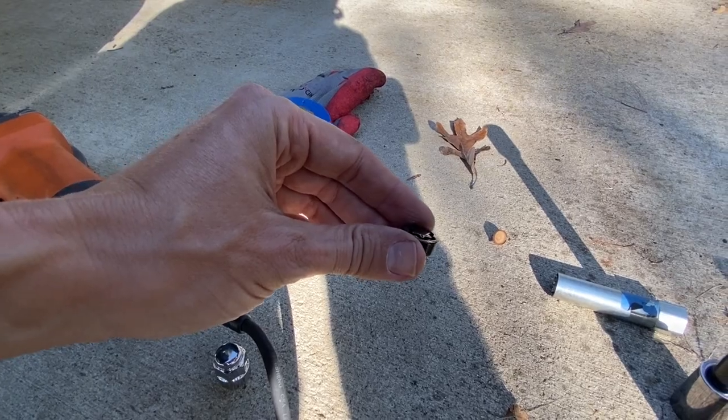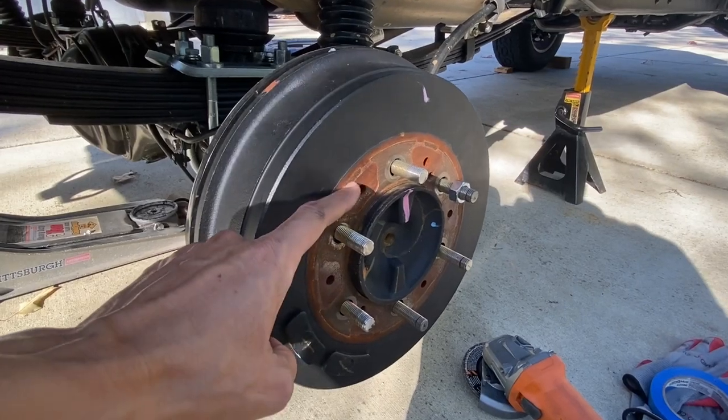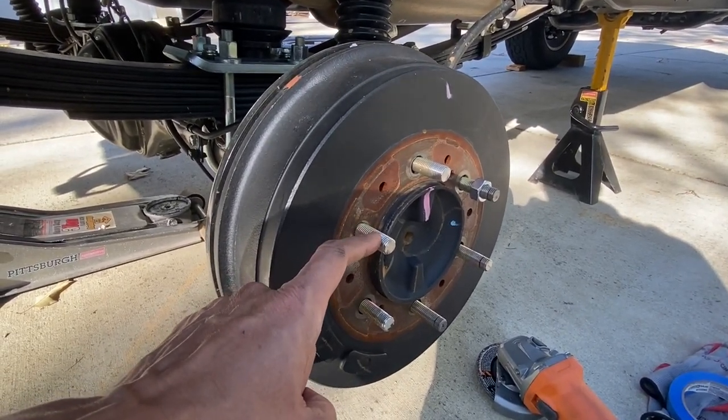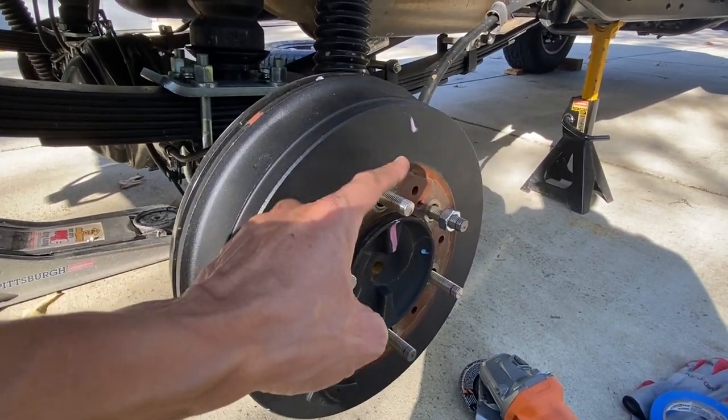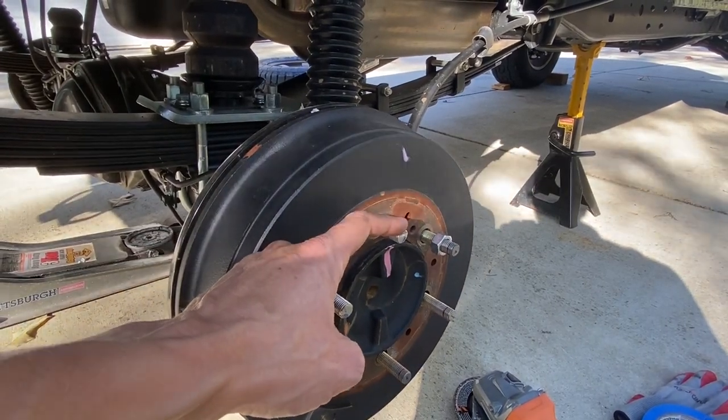This is partially my fault. What needs to be done when you put aftermarket wheels on a Tacoma or 4Runner is you basically have to change out the wheel studs, because the OEM wheel studs are not as deep as these. Unfortunately, these are ARP wheel studs and they don't come to the exact length you need, so you basically need to take measurements and cut them down yourself.